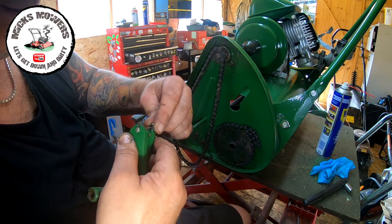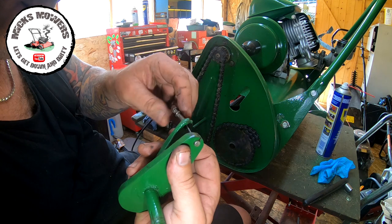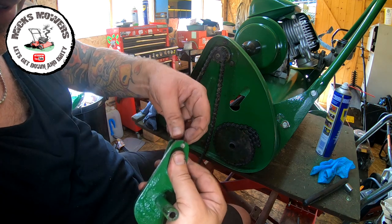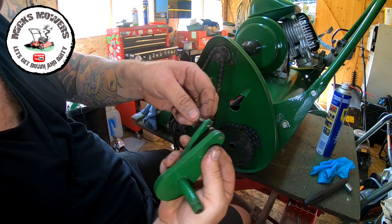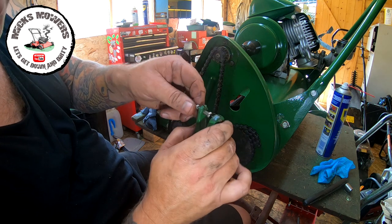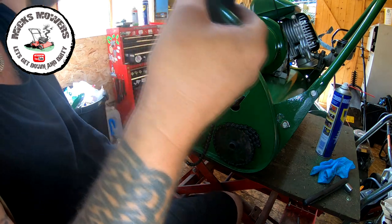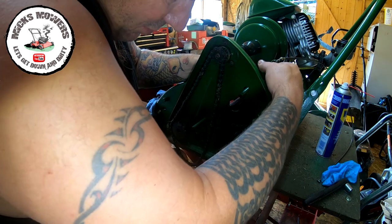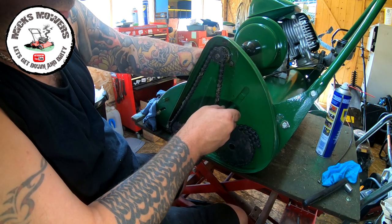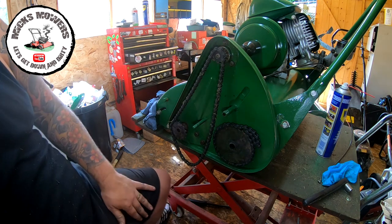Take the slack up on that. And that will go into there like so, under that bolt — that's better — then go into there and feed through, and that gives you your adjustment. What I'm going to do now is just put a little tiny nut on the end just to keep it together. As you depress this, it will move forwards and backwards, and there'll be tension under the clutch plate. So that will now go into position and just literally sit down to there. That little tiny piece gives you adjustment on the clutch plate. Sit them into there and that's now in position — then I'll get the clutch plate over and we can start to put the clutch plate on.